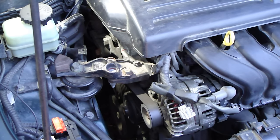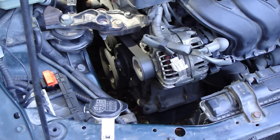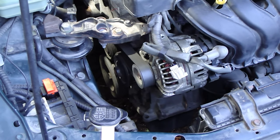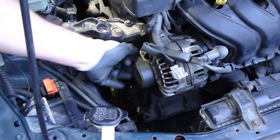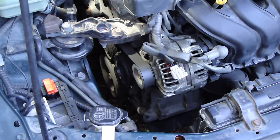The belt is running nicely, there is no sound, and it runs very smoothly, and our change has been successful. And when we made this motor test, everything works well, and there were no different sounds. And then you can also do the final check: you rotate this belt, and if it rotates quite easily about 45 to 90 degrees, then the belt tension is okay, because there is an automatic system. And now I think that this is very fine. Okay, and thank you.